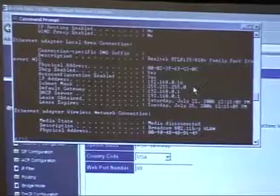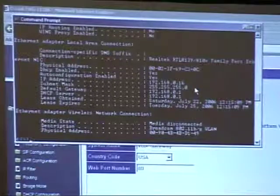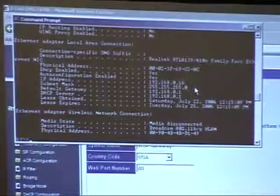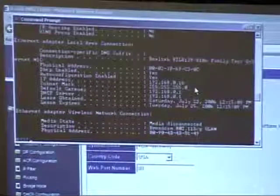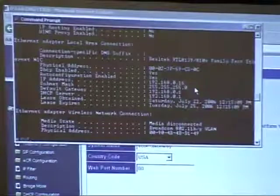My assumption was that they had not changed it this early. So whatever your password is, once you get into it, as long as you've got the same firmware that I've used in this, which you can also search the web to get, you will always end up in the 192.168.0.whatever subnet. So it's not going to be a case where that might have changed too. So once you've done that, and you've seen that your IP address has changed, then you would come back into your browser, and you go to 192.168.0.1, at which point you'll get this, and you can log in: admin and admin.